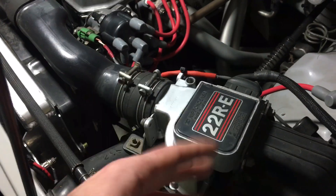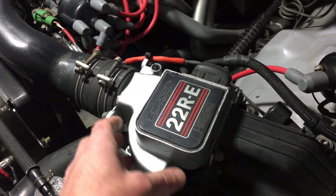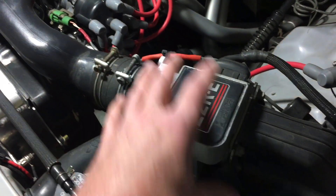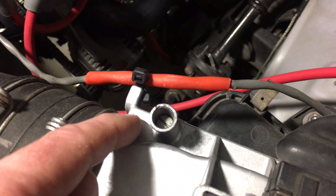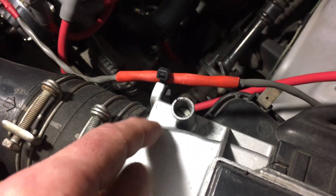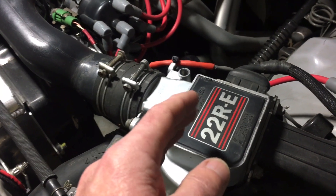There's basically a little door in here that is pulled open as air flows into the engine. As the engine cranks over or is running, it's drawing air and creating a vacuum. The air has to come in here, go through the air filter, and head this way. The electronics in here tell the computer roughly the volume of air being drawn through this metering system. This is more or less a bypass channel, and if you turn this screw all the way clockwise in, it will seat and block that channel.